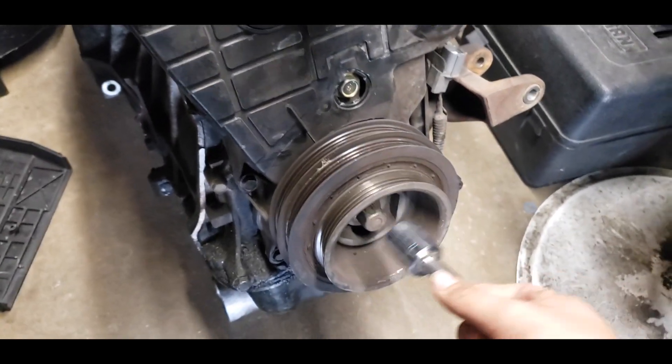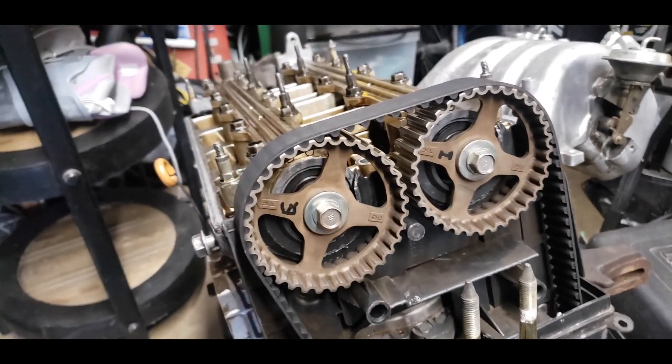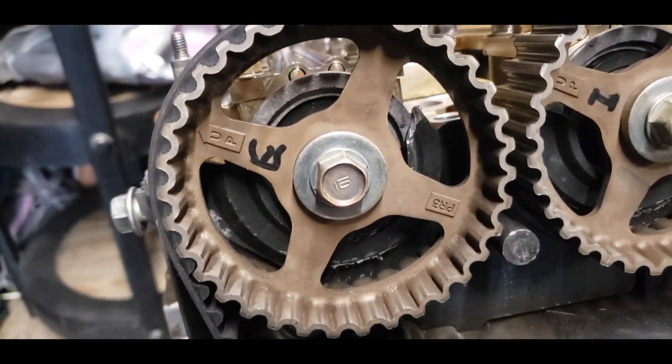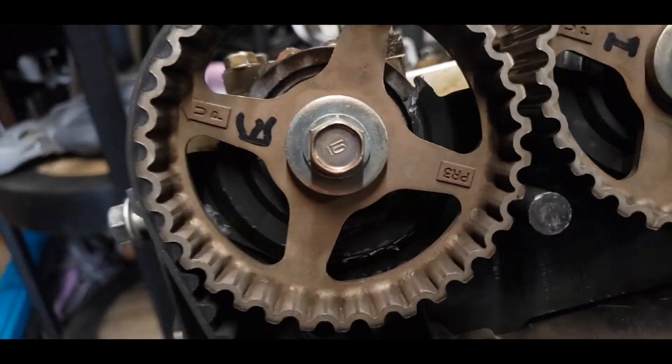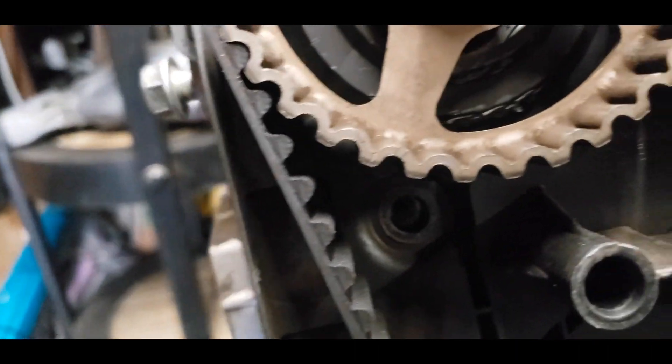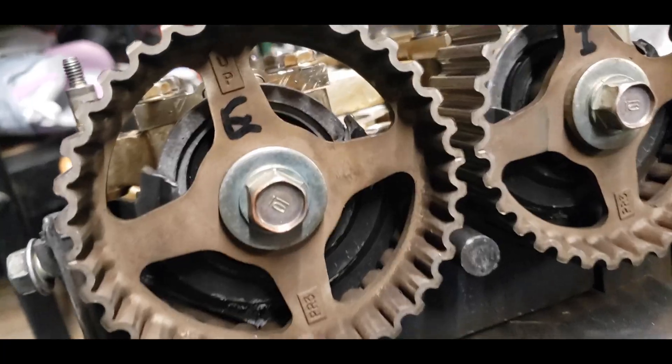3/4, and that fits in. I tested it a little bit by turning it — it does turn. I'll put it at top dead center. As you can see, it's not at top dead center, so I have to put this up and then something else a tooth I think, but I'll figure out as I go. Here it is — top dead center, they're both up.